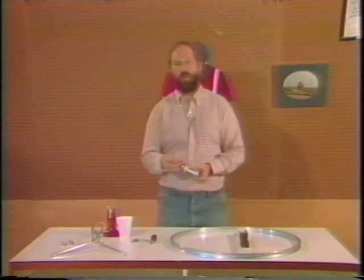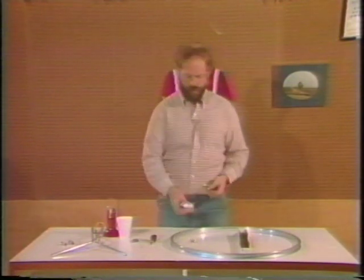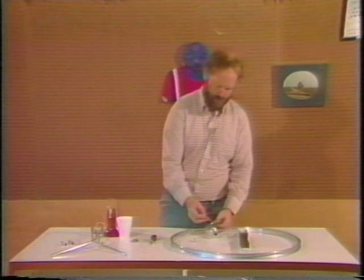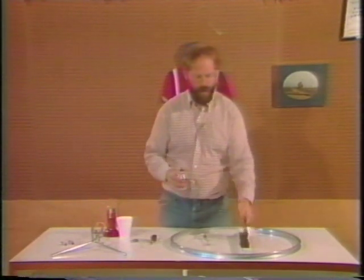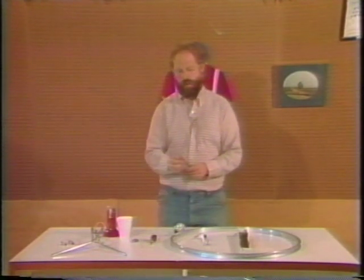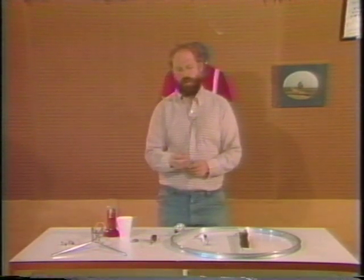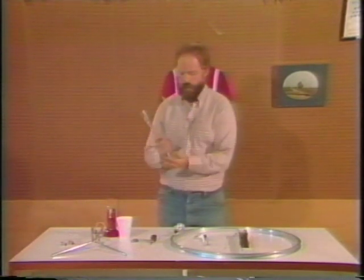Now we can start to actually lace the wheel. Might take the quick release out, it'll just get in the way. We're going to insert the head-out freewheel side spokes first, and pick out 9 spokes. 1, 2, 3, 4, 5, 6, 7, 8, 9. Don't forget to dunk the threaded ends in oil before you insert them.